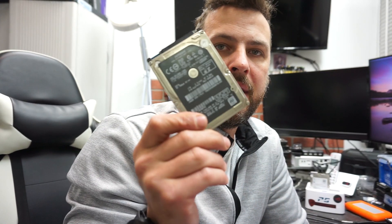The same procedure works for a 13, 15, or 17-inch MacBook Pro all the way to the early 2012 model. As many of you know, in late 2012 the Retina MacBook was introduced, and in that machine it's not possible to do this anymore because they already come with a solid state drive — it comes with a drive which looks something like this one, compared to a SATA drive which is present in early 2012, 2011, 2010, and so forth.